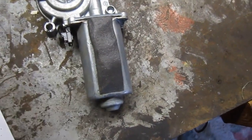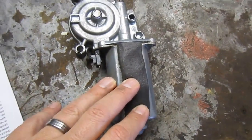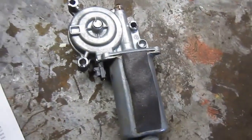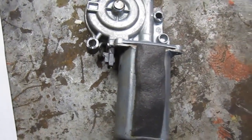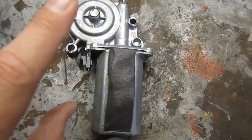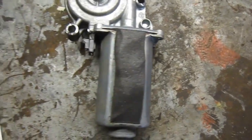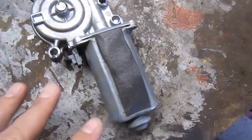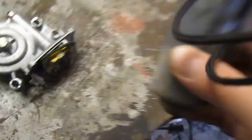I've got the four screws out. This is going to come apart really easy. What's nice about the second-gen body styles of these Jimmys, Bravadas, and the Blazer is that they use screws that take apart. The first gens had a weird thing where they were kind of bent over and smashed together, so those were a little bit harder to get apart. The disadvantage with this one is once it comes apart, it's kind of a pain. So I'm going to warn you right now — don't pull this apart unless you've seen what's involved in getting it back together in the rest of this video. This should just come right off — just pulling it straight back. It comes right apart.